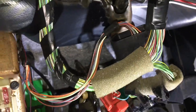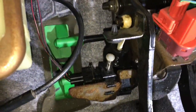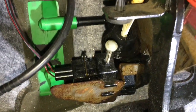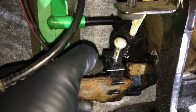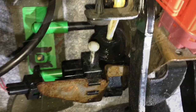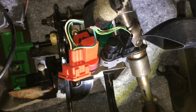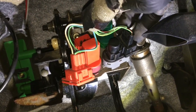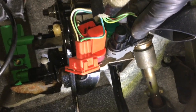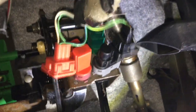Get your code reader cables and hood latch out of the way — just put them somewhere they're not going to bother you. Next thing is to disconnect this speed safety switch. You just press in this metallic clip and it comes out pretty easy. For the black and the green cables, there's again a metallic clip that you push in and it comes right out. Green is the same way — push in and it comes out.